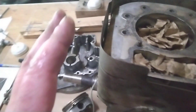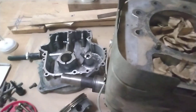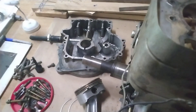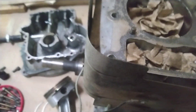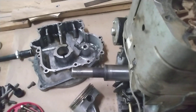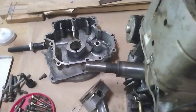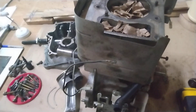What I have here is a 17 and a half horsepower Briggs & Stratton Intek. The symptoms were: anything around half throttle and above it would begin missing, backfiring, and just bogged down — zero power. It wouldn't engage; it would die as soon as you tried.